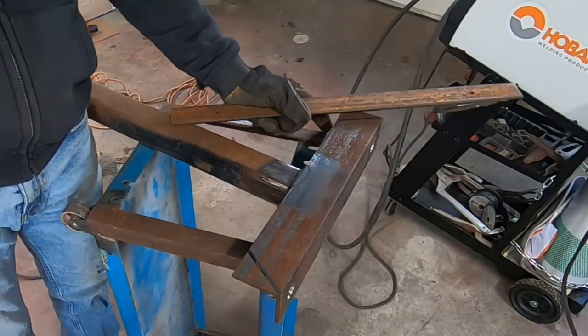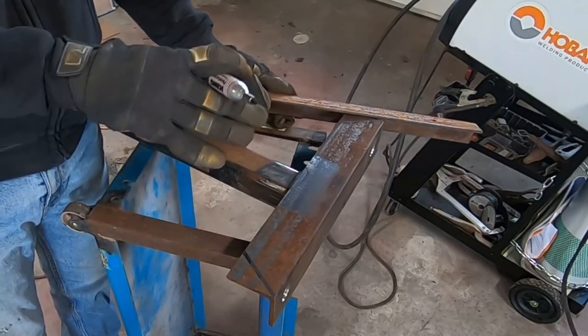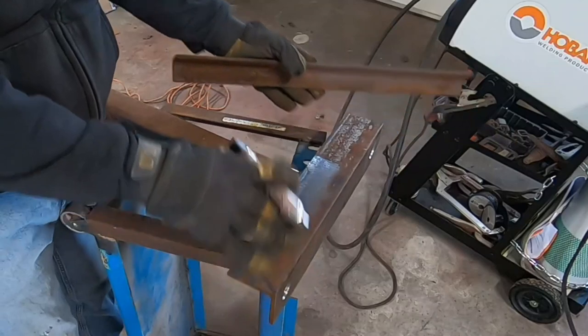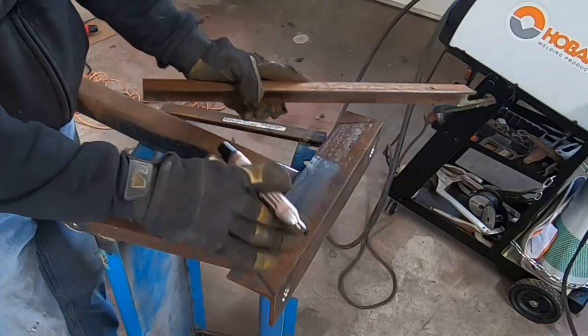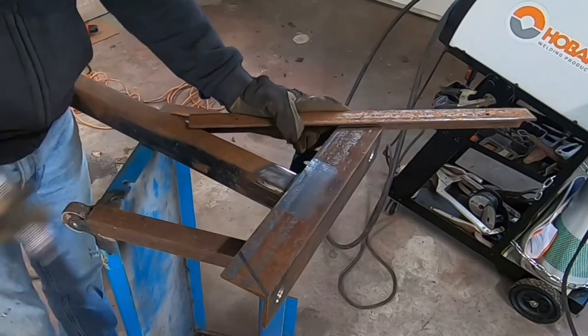So we're gonna have to cut this off, but I lapped it up over the top of the upright here and just shifted it until I got the very corner of the angle, and it would come down like that. And then I just simply marked it. Flipped it around, did the exact same thing here. It's going to be a shorter throw because I have a little angle. So if you look at the underbelly of at least an A-body on a Mopar, it kind of goes upward. There's a little incline to it. So this will be, it might fit both ways, but it'll be for one side. The other side will mirror image this one. And I did the exact same thing over here. So I made sure it was tied up against it and then did a mark there, okay?